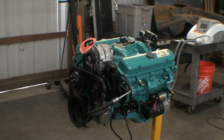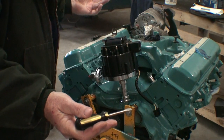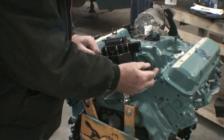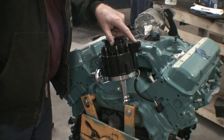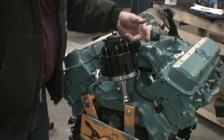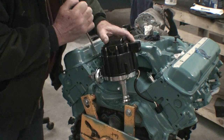So enough on that. I'm gonna pull the distributor out and pretend like I don't know anything, and show you how to do it. Just in case somebody doesn't know anything about distributors — that's the vacuum advance, this is where it plugs in on at least these HEI distributors. The wiring is going to plug in here also from the car. It says on top 'tach' and 'battery' — that's going to send a signal to the tachometer, and battery basically means switched power from the key. To take these off, just push down — you see that it releases. There are four of them.